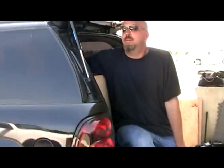But that ties into the whole service writer thing, because why didn't the service writer at any point say, you've been coming here every 3,000 miles, all we've done is oil change services and tire rotations, why don't we look a little further to see if there's anything else we might have missed? Because they missed the transfer case service at 50,000. They obviously missed 3 fuel filter services. I just think that if a shop is going to nickel and dime you for an air filter every time you bring your car in, they should look at the whole car like that and at least let people know.